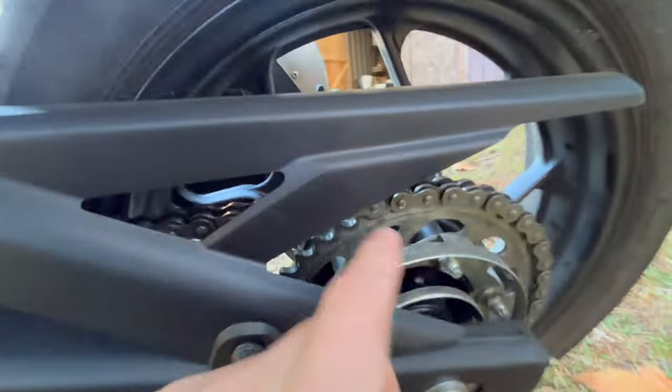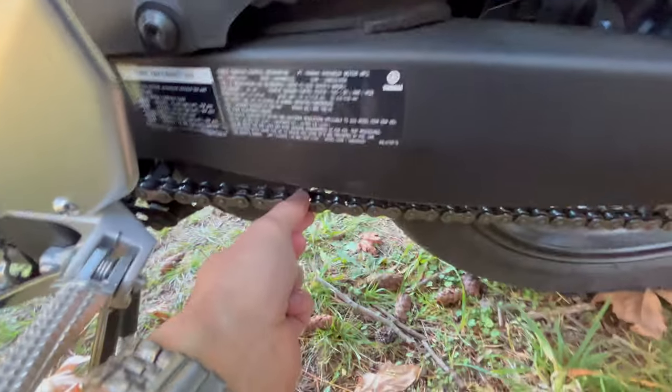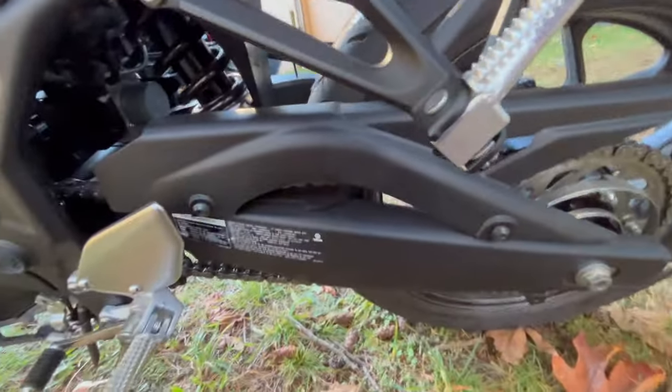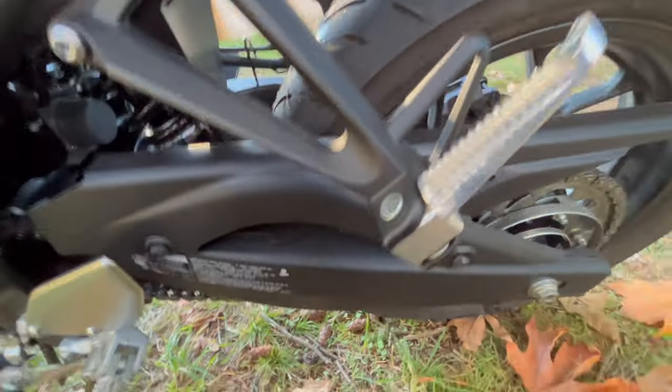If we follow along, this is the swing arm. So the engine's power output is through a gear up front connected to this chain inside this housing, and then the chain exerts tension on the sprocket on the rear axle. This is how you adjust the tension of the chain — you check it by going like this. The engine power is therefore transferred to the rear wheel. The chain gear in here is connected to the transmission so it can change gears one through six — the smaller numbers for starting out, sixth gear really for cruising on the highway.